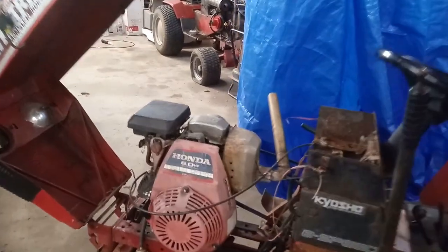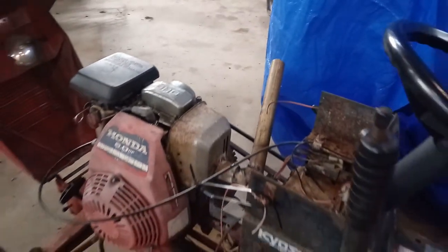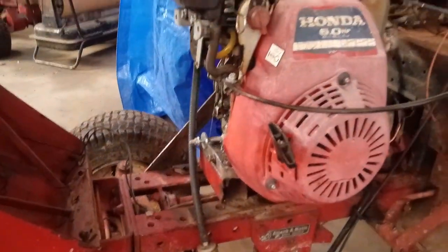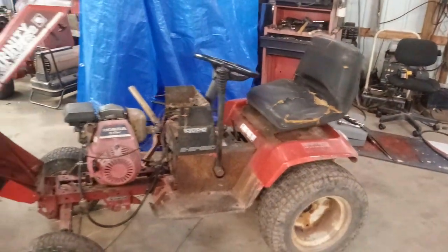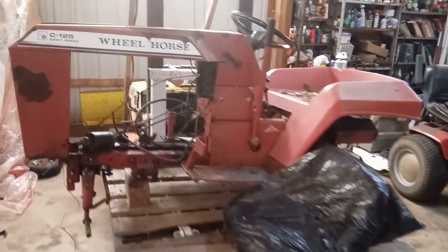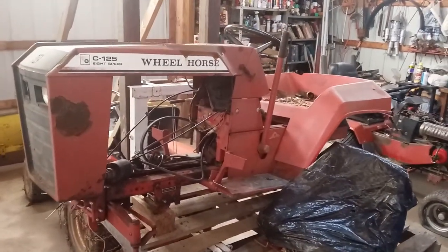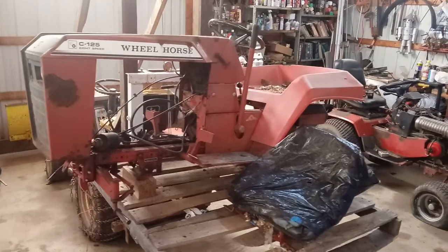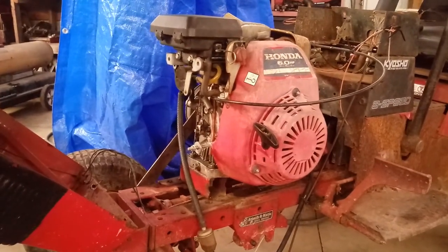As far as stuff done to the Honda motor, really nothing special. I had to change the exhaust obviously because the exhaust was blowing straight back at the center console. In this case I removed the gas tank and I have it running off the fuel line which is running off the stock gas tank in the back. Hopefully I have the option to do that on the C125 - its gas tank has not been cleaned out or used, probably in the last 10 years. So we'll see what kind of condition it's in. If not, not a huge deal - I can take the gas tank and mount it back on the front of the motor for the time being.